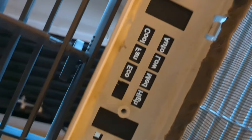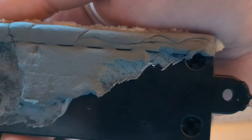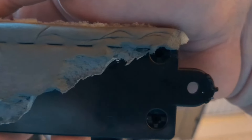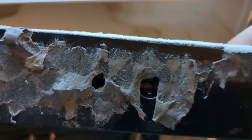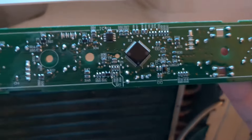Looking at the board, this is where the black box is going to sit. There are a total of four screws you're going to have to remove to pull the black box out. Two of the screws are easy to get to, but two of them are underneath this foam material that you'll have to pull off to get access. After getting access to the board itself, you'll have to pull three additional smaller screws — two here and one here — which will allow you to open it up and access the board inside.